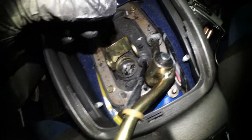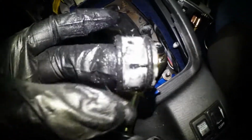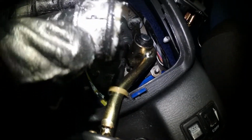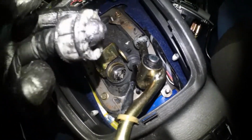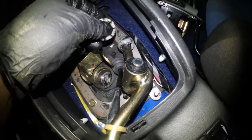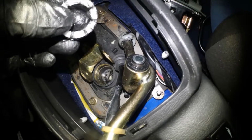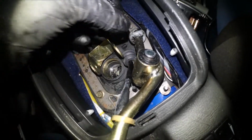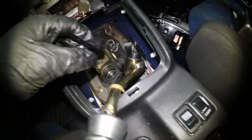This little part was attached to the bottom of the shifter bushing, and as you can see there are O-rings on there. One of these O-rings fell out while I was taking it out, so just so anybody's wondering if theirs falls out. And if you're trying to remove the bottom piece, just undo the top O-ring and this all should just spread out. Also, I'm going to need some grease. I need to pick some up.